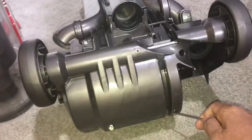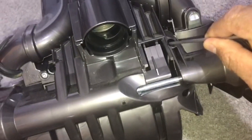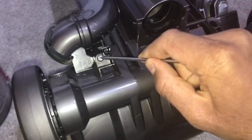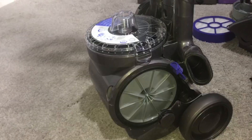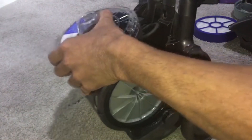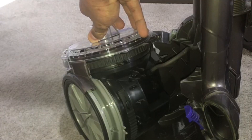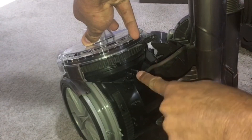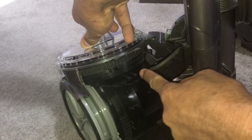Remove the four screws — here, here, here, and deep in there. Ignore the outer one, that's just for this little piece. The screws are now removed and the motor housing will come away. Just take note when reassembling: the wire goes through these two holders and this one here, so it's like an L shape.